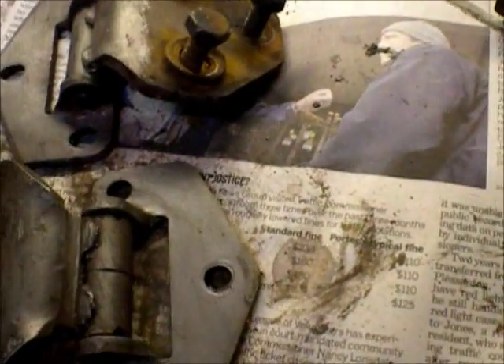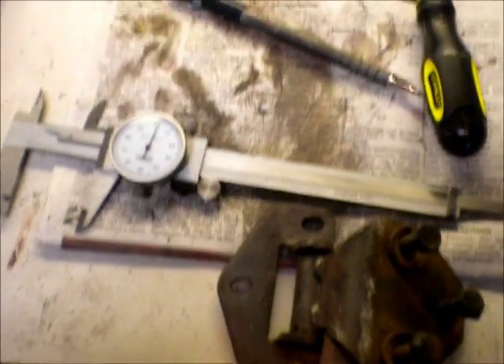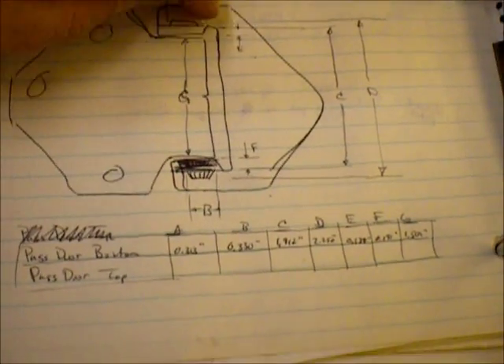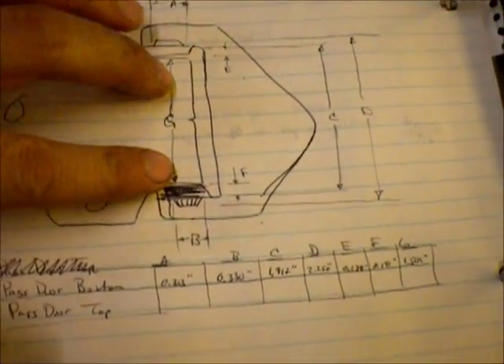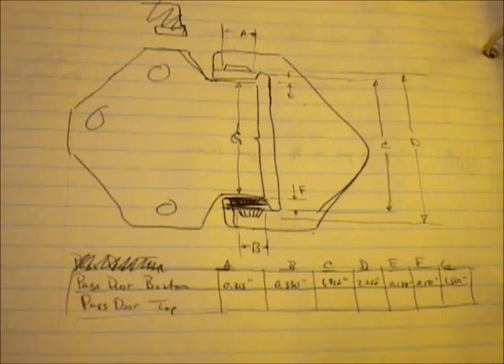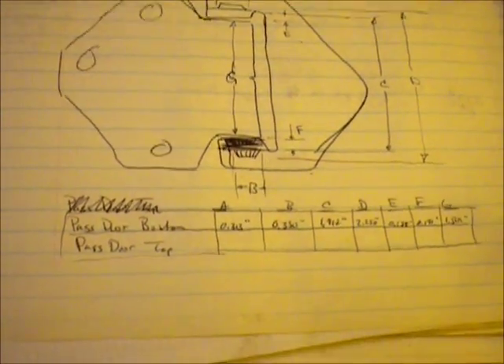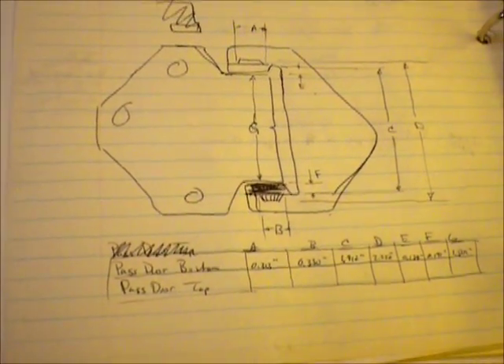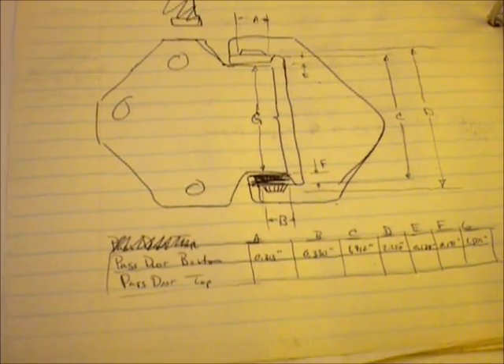So I'm going to try and get this pin out and see what happens. Before I go and try and source some pins, I'm going to measure the relevant dimensions — pin width at the top, the thickness of the flange, the thickness inside, overall thickness, and so on. It might be overkill, but I'm going to try and find some GM pins or something down at AutoZone or online, and this might help.